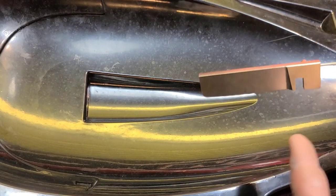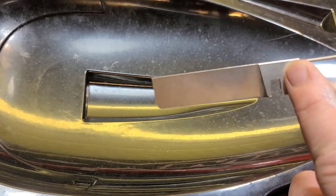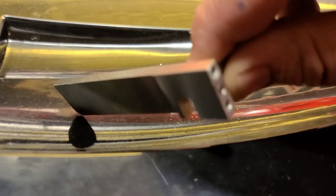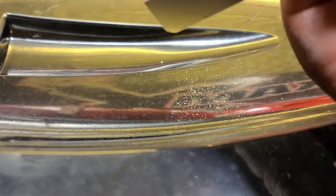Look at all this — see this right here? It's hard to see on the table. Just so you guys can see how much dust is coming out of here. You want to go past your threads so you don't mess up your threads so your nipple screws back in. See all that dust right there? That's actually aluminum from where I'm sanding — basically filing off the inside of this rudder, opening up our passage.